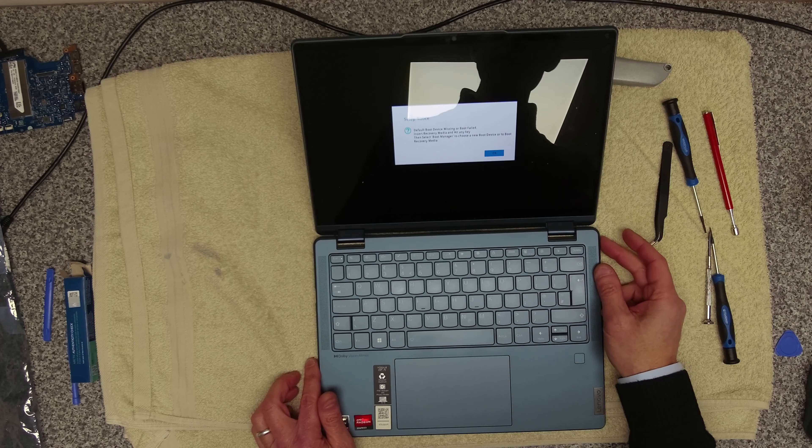Let's go ahead and get Windows 11 installed on here. That was the fairly simple task of replacing the main board on this device — all looks like it's working. We'll install Windows 11 and then run it for a couple of days just to make sure, because the problem before was it was constantly blue-screening. We ran some diagnostics and it failed on a couple of the memory tests. Because the memory is part of the main board, you've got no alternative but to change the whole motherboard, which is a bit of a pain — but this was £179 from eBay. We'll get Windows 11 installed and then get that back to our client. If you found that video useful, give us a thumbs up, don't forget to subscribe to the channel, and we'll see you in the next one.